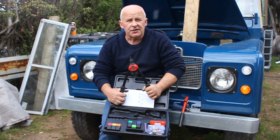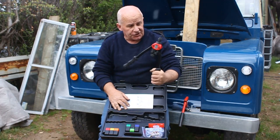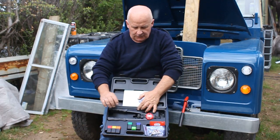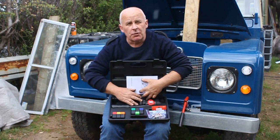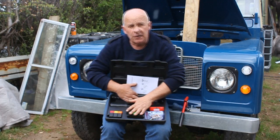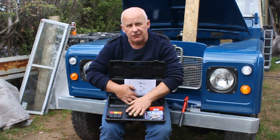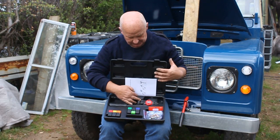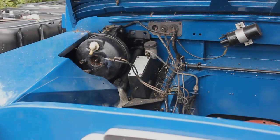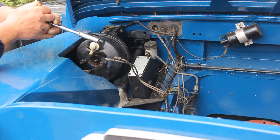These pliers come in different sizes. The larger the diameter bolt, the longer the handles will be and the stronger the head. On a Land Rover they only have them in one size which is three-eighths of an inch. I've chosen to go with 10 millimetre, which is the same size — the same size head just has a slightly different thread form. So now I'm going to take that bracket off the firewall and move it to one side slightly, and we can have a look at how a riv nut is fitted.